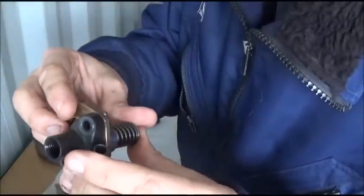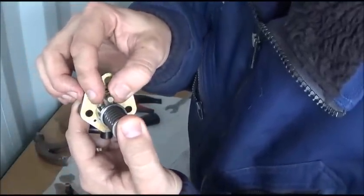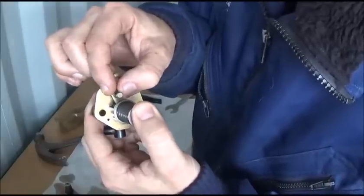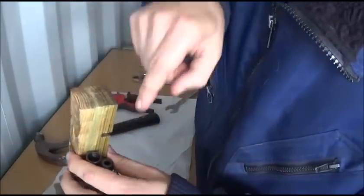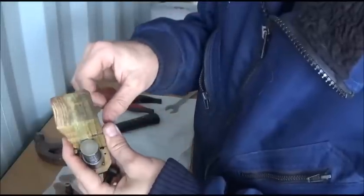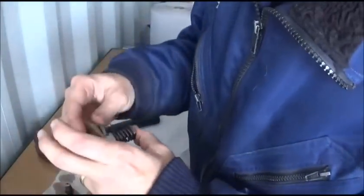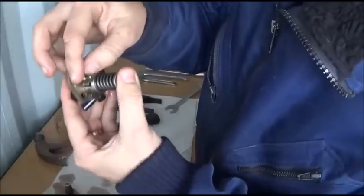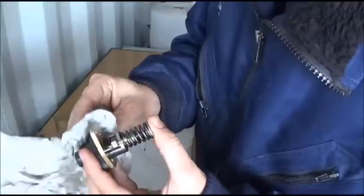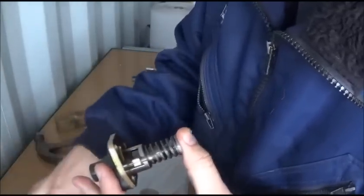If it's stuck at the top position, flip it over, put the block of wood on the bottom side, and hit it there until you free up that little nub at the bottom on the back end of the needle. Don't lever on this — if it is stuck, that's not the way to free it. Use the block of wood and the hammer. These are precision machined parts so you don't want to damage them. Then test it by moving it backwards and forwards — the more you work it, the easier it will be to move the needle. Once the piston is freed, you can use some acetone and a Q-tip to clean the inside and get rid of any glazing.